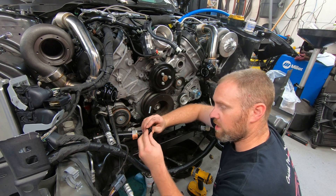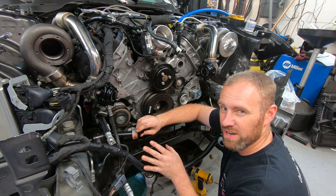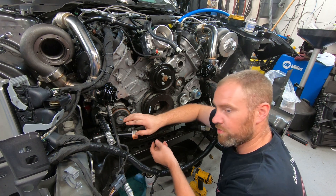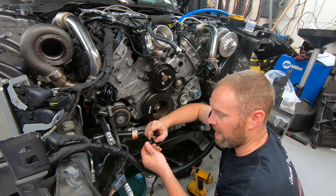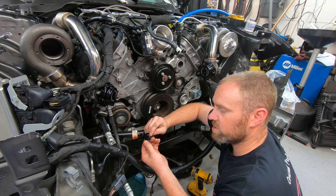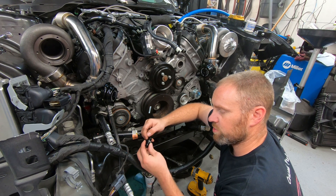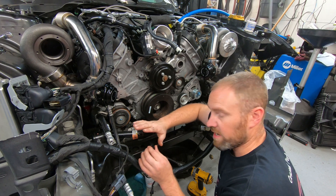Once I'm done tapping it, I'm going to apply epoxy on here because it's a plastic pan and I'm just not very comfortable without it. I'm going to tap it a few times and keep threading this in until it's tight when it bottoms out, because if it's bottomed out I'm going to have more support against this flange directly on the plastic pan. Then I'm also going to take some JB Weld and put it right on here, because once that's on there it's permanent — it's not coming off.